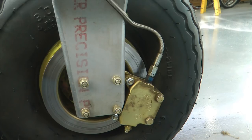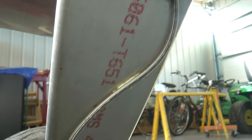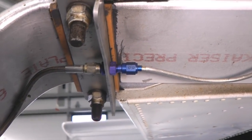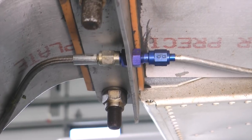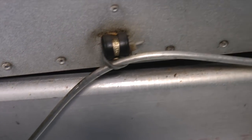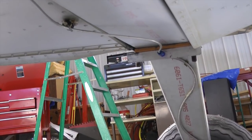Let's look at a sample brake line installation on this aircraft. We start at the caliper at the wheel with a flexible hose that runs up the gear leg — the gear leg flexes, so the flexible hose works fine. It then transitions to aluminum Versa Tube through a straight-through bulkhead connector mounted to a bracket on the aircraft. The Versa Tube then follows toward the center of the aircraft, steering clear of the gear leg as much as possible, and heads to the front of the aircraft.